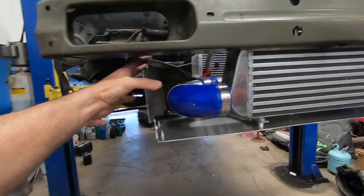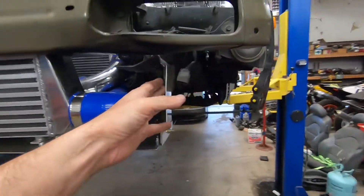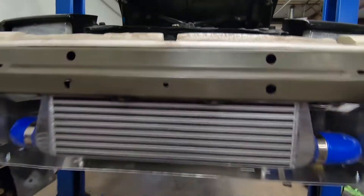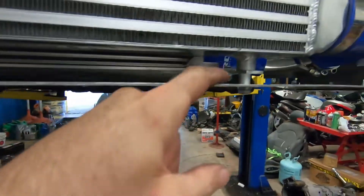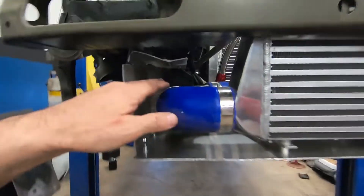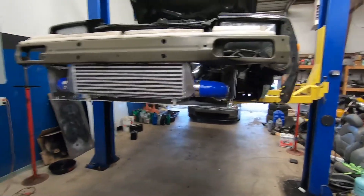I still need to bend this side in a little bit more to make it match the other side, but no big deal — it's got a little more gap on this side than that side, but it looks great. This is the first side I started with, and once I figured it out, the other side came out just a little bit cleaner. All in all it's going to work pretty well — it's going to grab that air and really force it up towards the radiator. You can see the standoffs down there, and I used rib nuts on the bottom for these side brackets. This thing is very secure and I'm really happy with the way it came out.